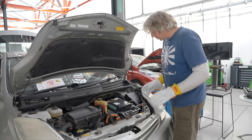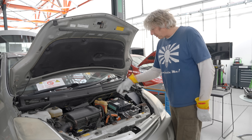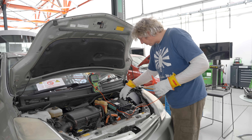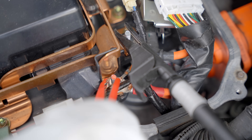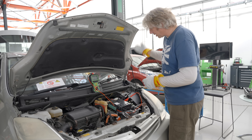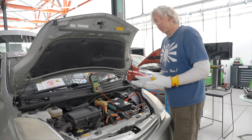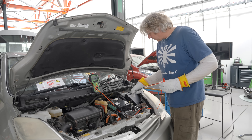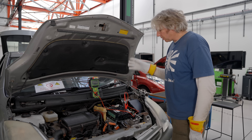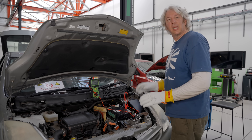But now I need to do another check. Before I can do any more work on the vehicle, I need to do two checks — I need to check there is no high voltage coming from the battery pack, because obviously we think we've isolated that, and I want to make sure there's nothing there. So I'll need my multimeter. I'm going to connect up to the terminal coming in from the battery pack — that's the negative side, that's the positive side — and you can see we have no volts, which is great. As we expected, we've disconnected the high voltage battery and now there's nothing here. But then just to be absolutely sure, because of all the capacitors here hanging on to all of that electricity — hopefully they're just discharged by now — we're also going to check the voltage there as well. Again, we've got no voltage showing, so the capacitors are definitely drained out as well, and we definitely haven't got any high voltage coming from the battery pack, which means this car is now safe to work on.